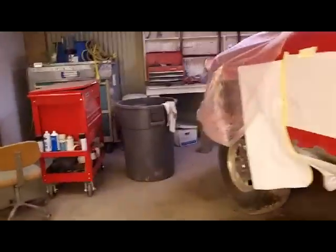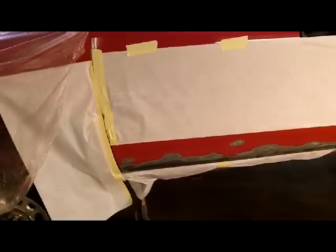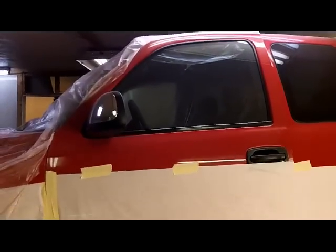I'm not a big fan of the rattle can etch, so I'm going to go with that. They didn't have any Matrix at the supply store, and I ain't got that kind of time. So here's what we got. Everything's masked up here. You can see I don't have that bagged up at the top, which is not a problem. I'm going to spray this at such low pressure that we shouldn't have any issues. Done it before.